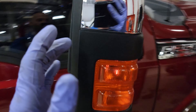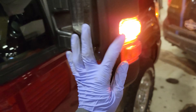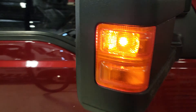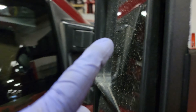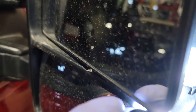We're gonna start by going to the passenger side mirror — you guys can pick the left or the right. I'm gonna leave the lights on so we can see them immediately turn on when we make the electrical connection. Go over to your driver's side mirror switch, turn the mirror all the way in, and you're gonna look for a silver tab that's right in there.